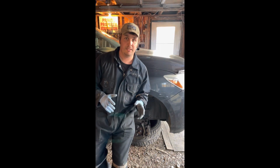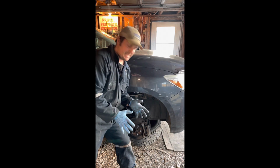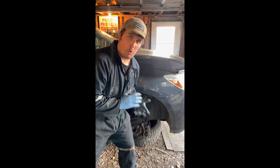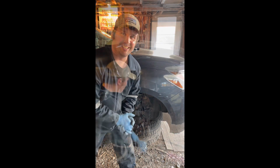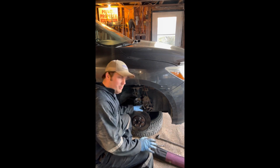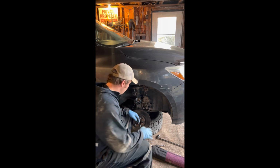I'm not a mechanic, but my brakes are bad. I've got noises coming from my brakes that brakes are not supposed to make. So we're gonna take them off and put new ones on and hope that fixes the problem. If it doesn't, well, that just stinks, doesn't it? I don't know how well you can see this, but it's important to not let your caliper hang on your brake line, I'm told. So we're using high quality material, baler twine, to solve that problem.